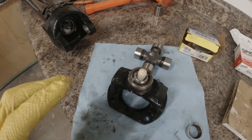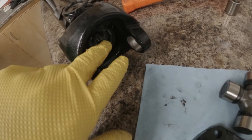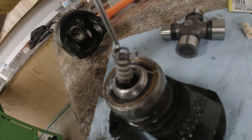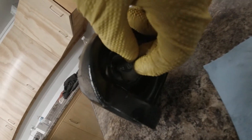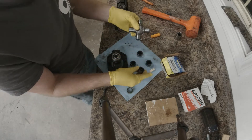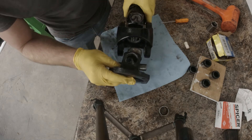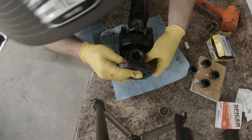Now is the most difficult part of everything. You have to assemble all this and put the caps on while holding it together — getting the centering pin into the centering ball — so it's a little bit tricky. We'll take the spring out of here and put the spring in our centering pin right there. Pull all the caps up for our U-joint to get it ready. Now we'll start the U-joint and put it into that piece there. Then slide the centering pin into position, all while working that U-joint in there, which is the tricky part.